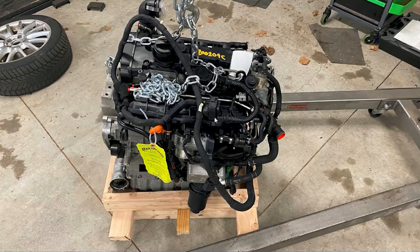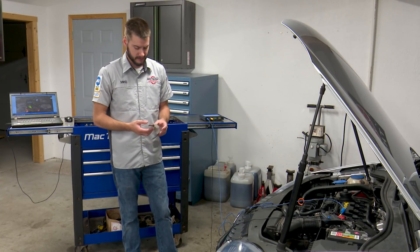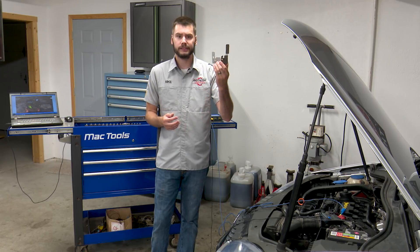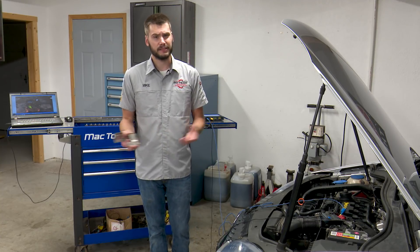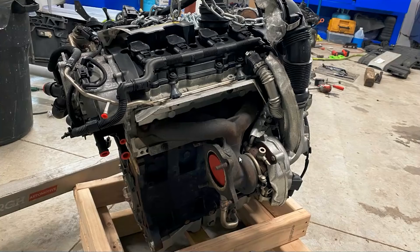The engine actually came with the wire harness all the way back to the PCM, which leads me to a comment. Who has ever seen a theft deterrent device on a PCM connector? This piece of aluminum right here had breakaway bolts like you would see on an immobilizer or ignition switch under the dash, where you tighten the bolts and the head breaks off. This little bracket was held on with that so you can't unplug the PCM without removing it. I guess that's because the PCM is located under the hood on this car. I was very happy that the new engine came with a full harness — it saved me a ton of time rerouting the old harness.